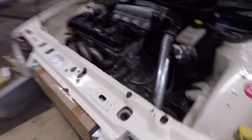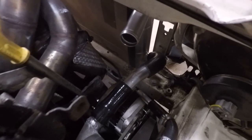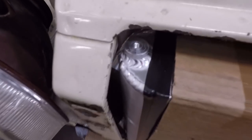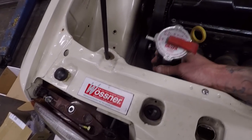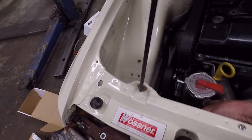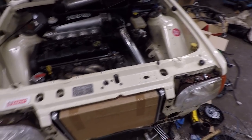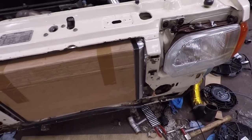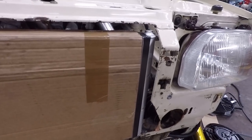I actually almost have a radiator. All the inlets and outlets are done, the bottom mounts are done, and I've started on the top mounts - they're going to bolt to here and come through the original mount. They need to be removable so I can get the thing out. This is also where I'm going to have the filler, as opposed to the head tank over there.